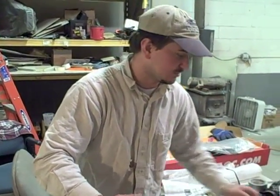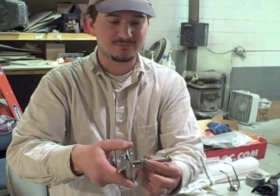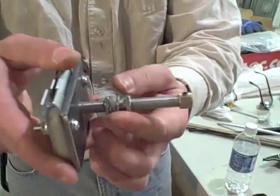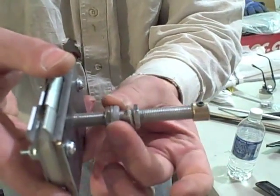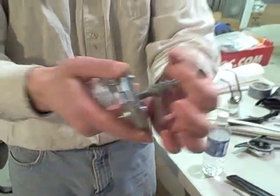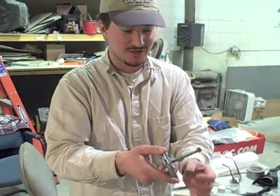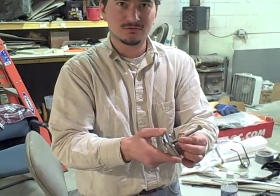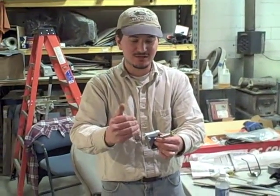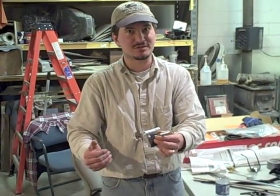So they have to be perfectly sealed — that's where these arms come in. We can make them to the length we want. There's a sealed fitting on here, so the only hole to the outside is where the shaft goes through. We slide it through, tighten this nut down, and we've got a watertight seal. All the mechanism runs on the inside, which prevents any water intrusion from getting into the vehicle.